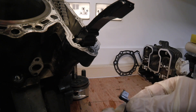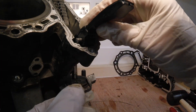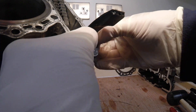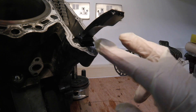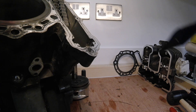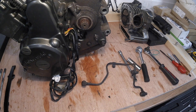This little piece that fell out when I was removing the cylinder head keeps the front cam chain guide in situ when the cylinder head is on. In terms of refitting it, you simply push it on like that — when the head goes on it keeps the whole thing in position. Right, got the feeder pipe off — let's bag it up. Of course that doesn't fit, let's go find something that does.